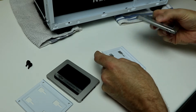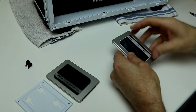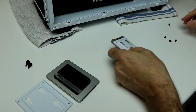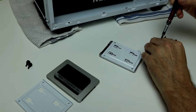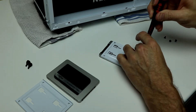When you're ready to mount the SSD drive onto the actual bracket, make sure you have the connectors pointed in the correct direction. I've done this so many times — I'm in a hurry, I bolt them down, and I end up facing the connectors in the wrong direction. It happens all the time. Just make sure you look before you start bolting stuff down.